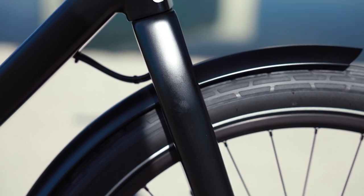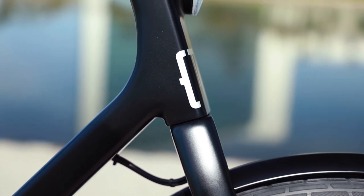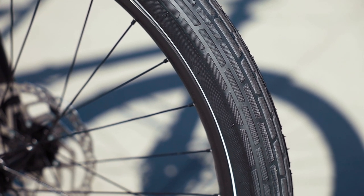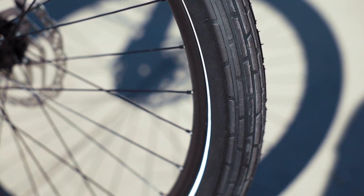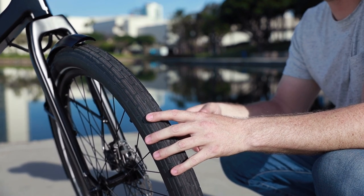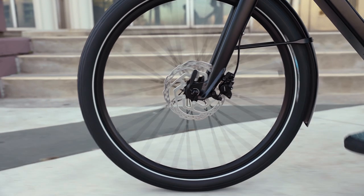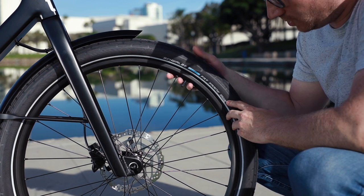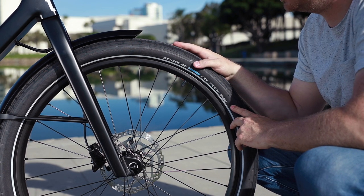This bike doesn't have any suspension — it uses a rigid fork, which really works well with the design of the frame. But it is still a very comfortable bike, mainly due to the tires. This is a 26 by 2.35 inch wide balloon tire, so you can run it at a little lower pressure and it's made to handle that with a heavier-duty sidewall. It's a tire made for urban riding with a little bit of tread that could handle some light off-road like dirt roads, but not real mountain bike trails. It's called the Schwalbe Fat Frank, and it has the K-Guard for extra puncture protection. It's really well-suited for this bike and definitely adds to the comfort.